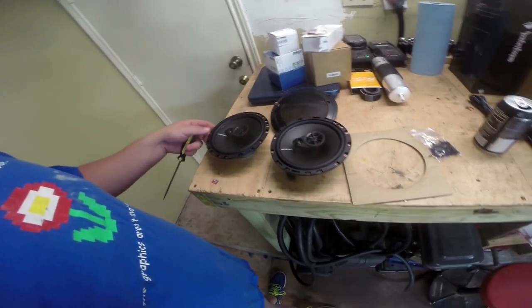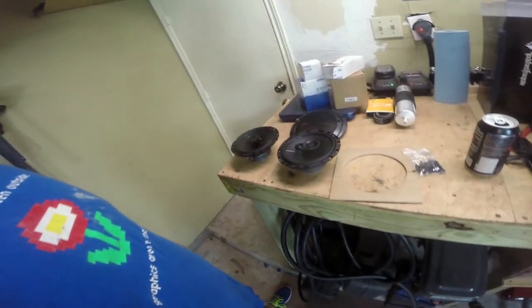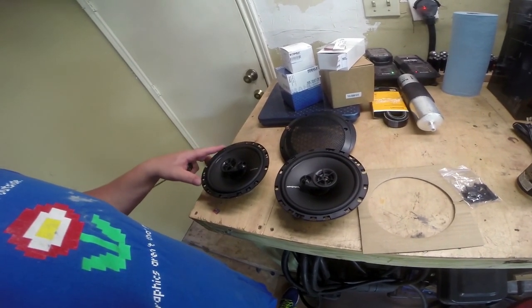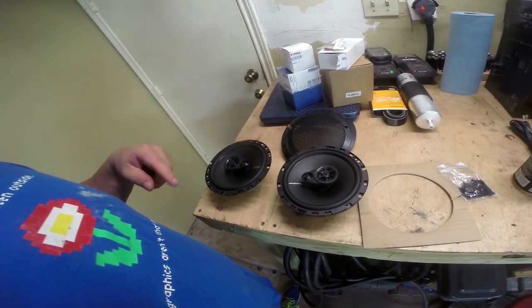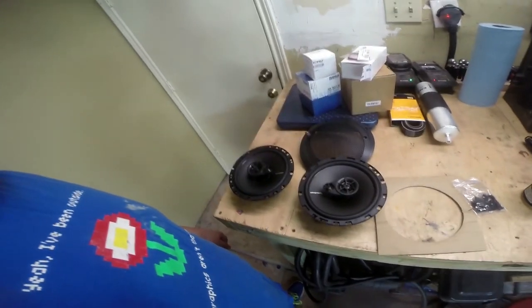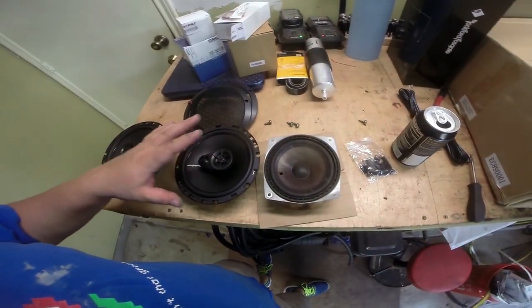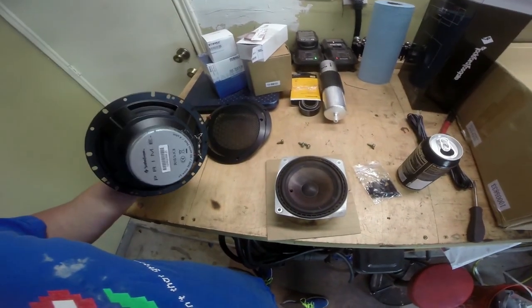The next little mod we're going to do is fit these 6.5-inch Rockford Fosgates — we're going to put them in the front fender wells. The stock size is I believe 5.25 inches, and this car actually has the original stock BMW speakers. We're going to take those out and we'll have to trim a little bit of material to make these fit, but it should go without too many problems. These have built-in tweeters versus the single-cone stock speakers. So now we're going to get this thing to fit in there.